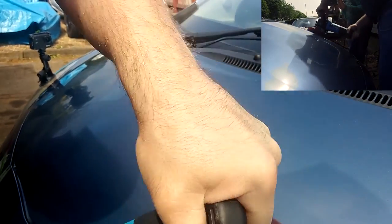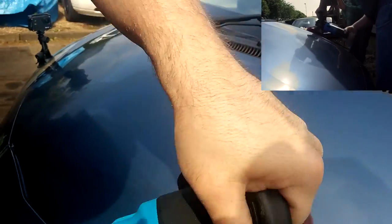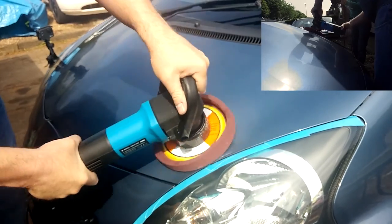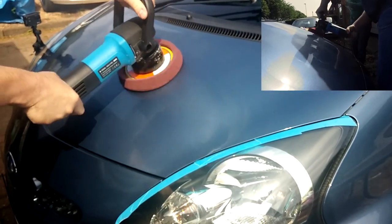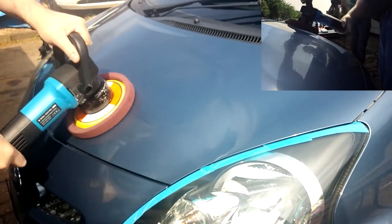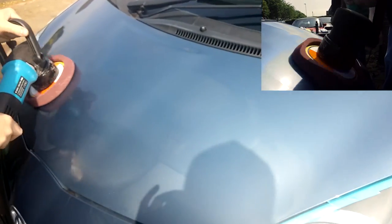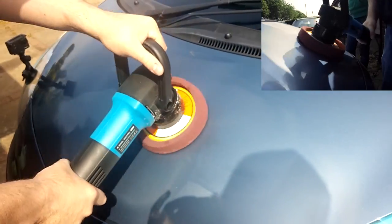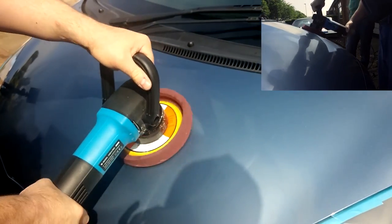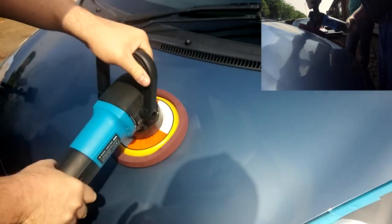After this there's a third pass as well. I don't think there's too much need to show you the third pass on the hood, but for that third pass we go back to Meguiar's Ultimate Compound. The reason for doing that: we start with Ultimate Compound to see how it does, go to Scratch X2 because we need to work harder to take the scratch out, and then go back to Ultimate Compound to get a nice finish on the bonnet.